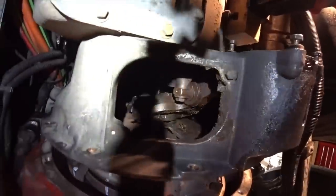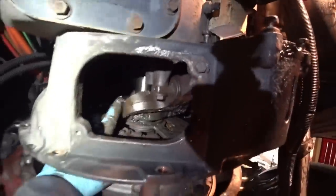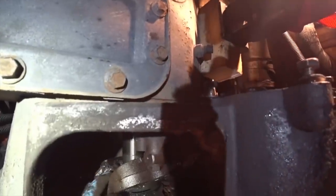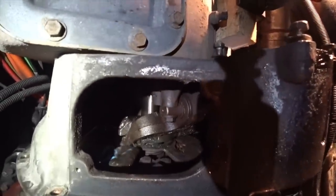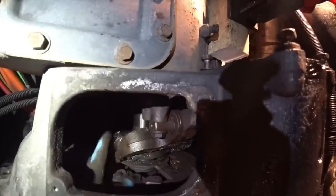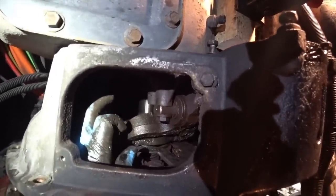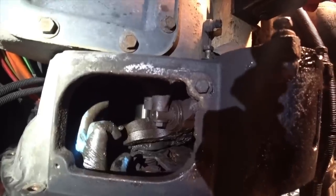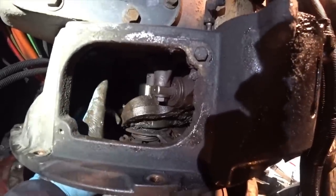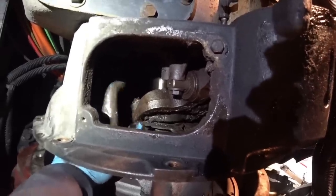This is the tricky part in putting this motor in. This right here is actually your clutch arm. When you depress the clutch up in the truck, it pulls this backwards. It goes that way, which pulls your throwout bearing, which is connected onto your plates. Not really the plates, but the pads in it. And it separates them, and that's what lets it out of gear. Then when it comes backwards, everything is spring tight and your clutch engages.